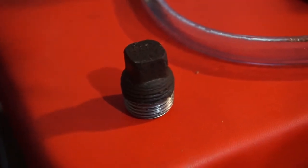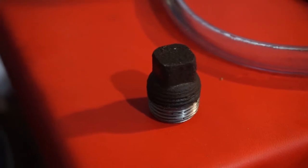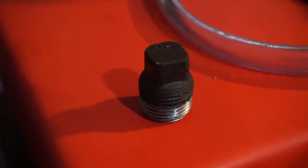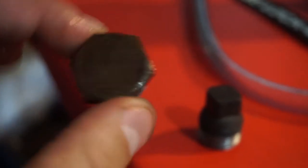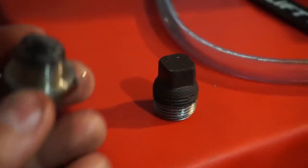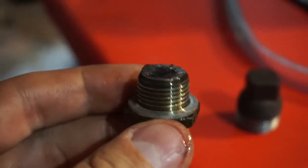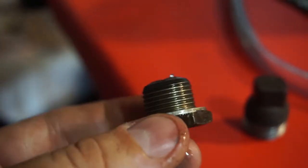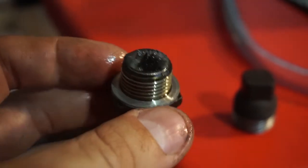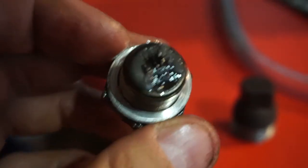Okay, so on the manual transmission on my year, 1995, this is the fill bolt. It's on the driver's side of the transmission. Then the drain bolt looks like this, and it is on the very bottom, a little further back on the car, facing downwards. And this is 14 millimeters. This is 24 millimeters, or 15/16 inches, which I had to use. So it is now draining, and it is just over 2 quarts to fill it, so I think 2.1. As you can see, all of this gunk that's on the top of that, I'm going to clean that off and then replace. Alright, so that concludes my fluid swap.